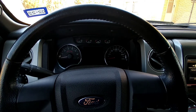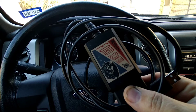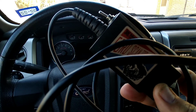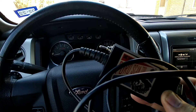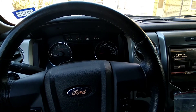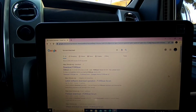So I did a quick Google search and found out some information on a tool called FORScan. I wound up buying this off eBay — it's about 15 bucks. You hook it up to a laptop via the OBD2 port and a USB. You've got to get the one with the switch; the Bluetooth one will not work. You need the one with the little toggle switch.